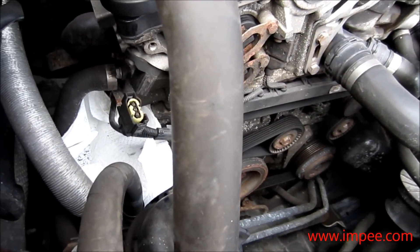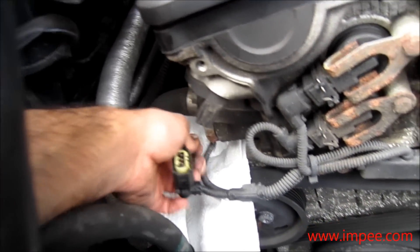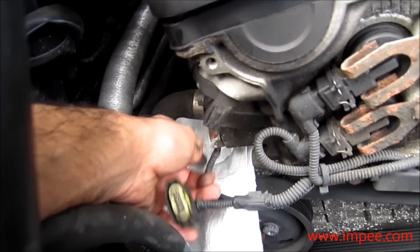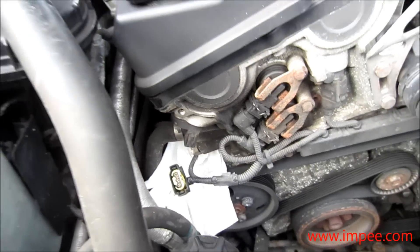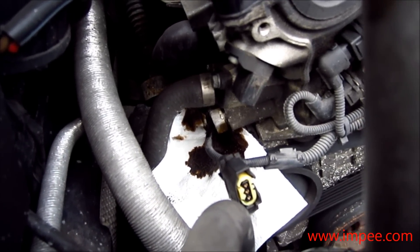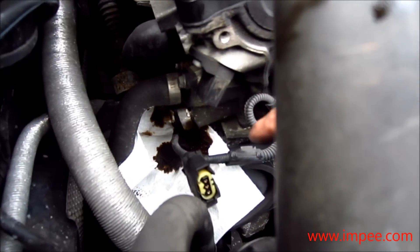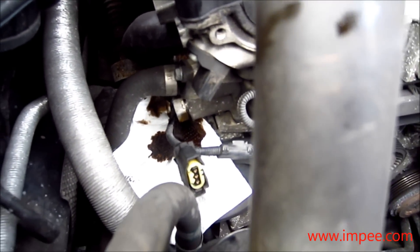Use the spanner — once you've loosened it with the spanner, slowly... the engine's still quite hot. As you can see, I've just loosened it and some of the oil started to drain out. I would continue to remove the whole timing bolt, but it's too hot because the engine is really warm, so I have to wait a short while.